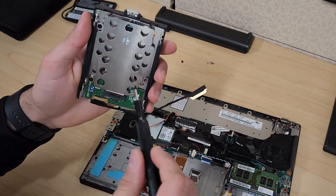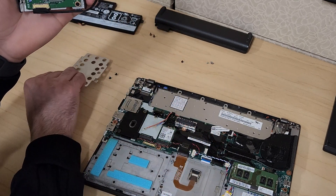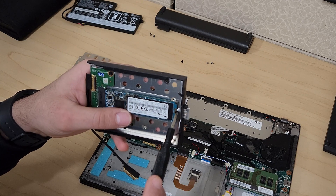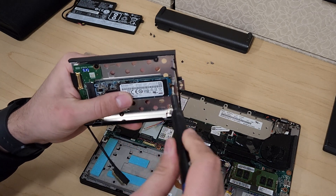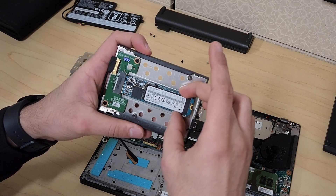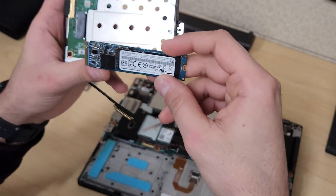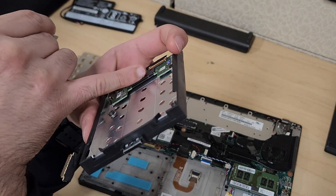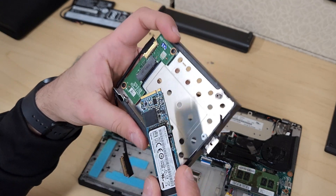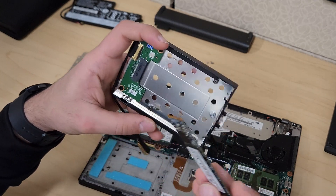To access our M.2, you want to remove these two screws that will remove this case cover, and then this will come out just like so — and there's our M.2. To remove the M.2, there's one screw that's usually holding it down. Remove that screw, then pull it up, go left and right, and it will come out. This one has the one notch.